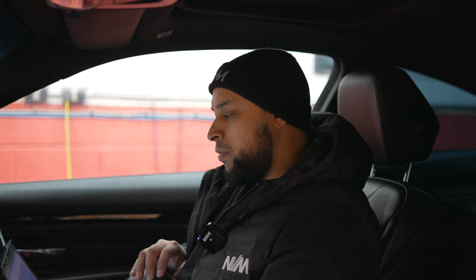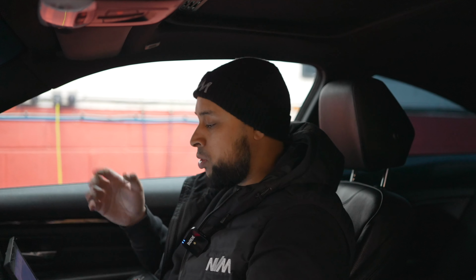There's no issues at the moment. Top end, I am seeing about 680 degrees of EGT, so we need to chuck a bit more fuel in there, but I don't want this to be a smoky machine. It's very easy to fill it with loads of fuel, loads of boost, and it becomes a smoking train, but we want to make it as consistent, reliable, efficient and smokeless as possible.